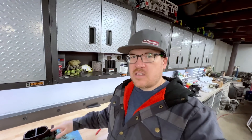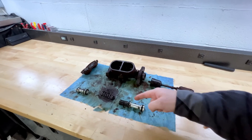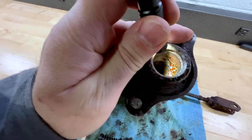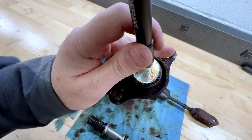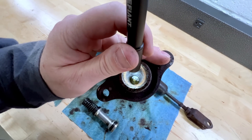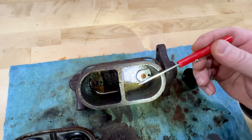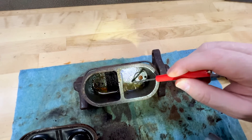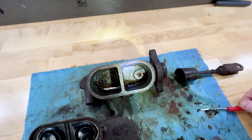As that moisture content increases, it's going to start causing rust and corrosion inside these components — specifically for our master cylinder, inside the bore where these seals sit. You can see all that corrosion all the way down. There's a lot more up at the top end, but it does have corrosion all the way down to the bottom. You can just see all the gunk and buildup in there — some of it is rust, and another part is where the fluid starts to coagulate and wax up and build a hard residue, which causes a whole slew of other problems.